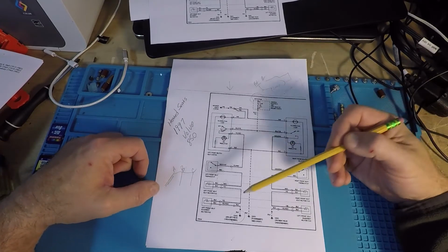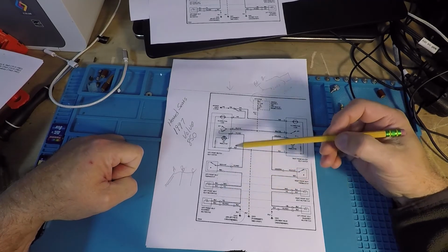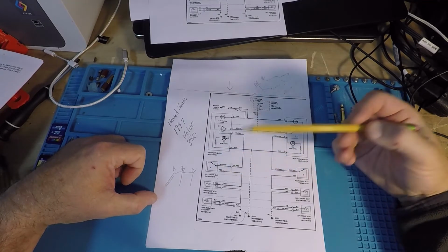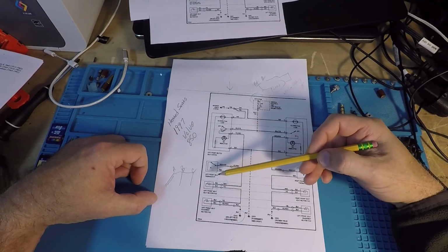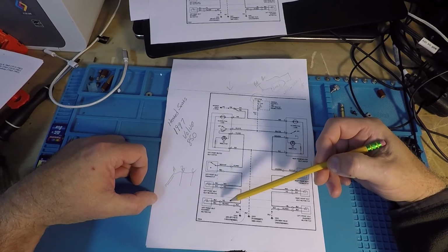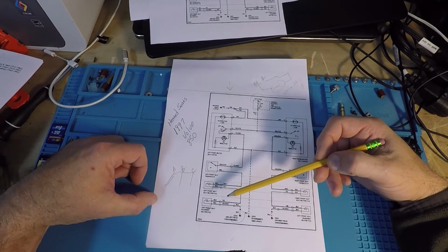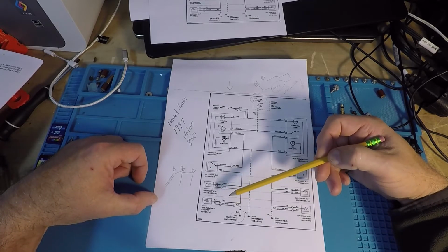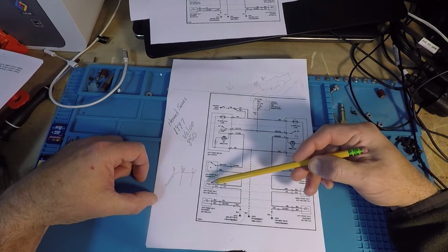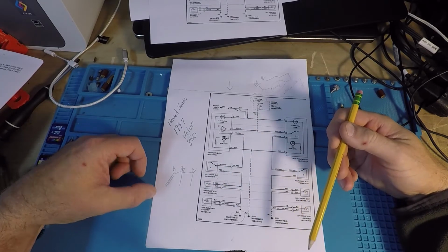In this case, that's exactly what's happening on my driver's side. I found it. I fixed a wire right here on the thermostat. One of them was broken. Don't ask me which, because it's very hard to see up in there. And then we came down, and the lower seat pad is bad. It wasn't bad before. It was working for a couple of days, but I think once it had restored current after Lord knows how many years of not working, the current flow basically wicked away at whatever was left and then burned out. That's my theory.